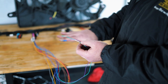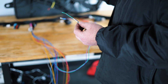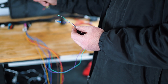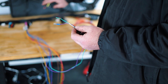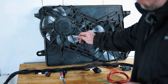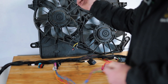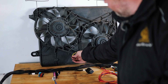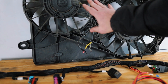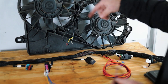They trigger ground through the ECU. So when certain parameters are met — temperature and so on and so forth — they just complete the circuit. When they do that, they pull in the relay, which is a little electromechanical device that will pull a coil in, trigger it, and then send voltage from the battery through the relay out to your fan. It's only going to push power to the positive side of each fan — fan one or fan two. Your grounds are going to go off to a good ground. These are heavy duty because they do pull a lot of amperage, so that's why you want to use a heavier relay — these small wires aren't going to be enough to supply a ground trigger to turn that fan on without damaging the ECU.